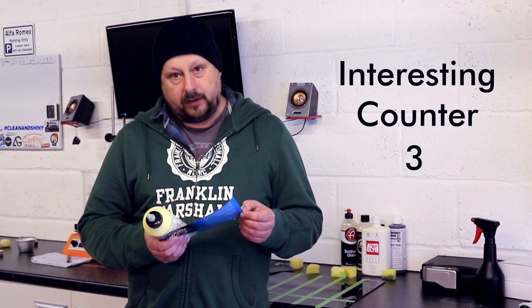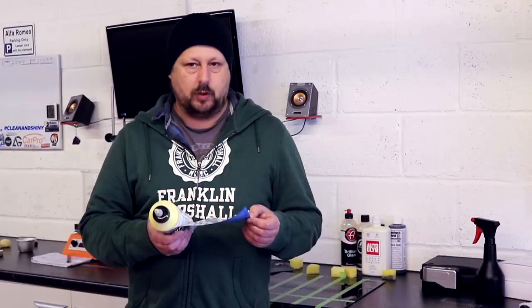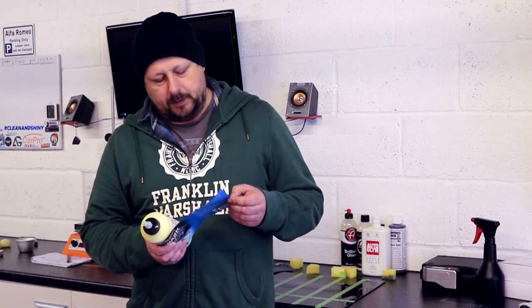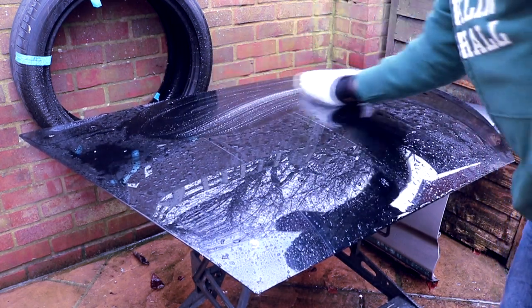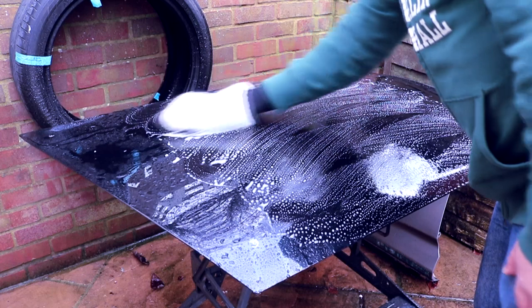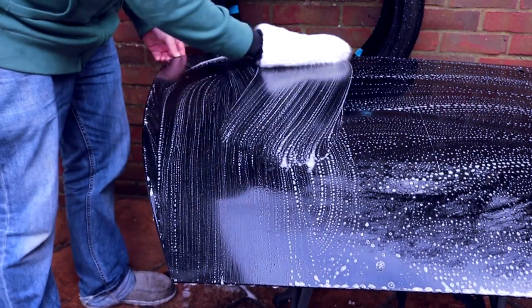For additional cleaning such as tough bugs and scuff marks, use a polishing action with multiple passes of the wash mitt. That's interesting, because remember we're in the process of cleaning the car here, so there's dirt involved as well. Car Wash Plus may also be used as a bucket wash — you can squirt some in a bucket, it is soapy, it will foam up and you can load it that way. Since it is super concentrated, mix it at one fluid ounce per three gallons of water. For best results at maximum cleaning though, apply directly to the wash mitt. So Meguiar's are encouraging you to get your wash mitt wet, rinse the car off to knock off most of the dirt and debris, then lay a ribbon of product over the mitt and work it — go in and do your contact cleaning. They use the word 'gentle' when you wipe over the panel, which is interesting — we'll talk about that a bit later on.